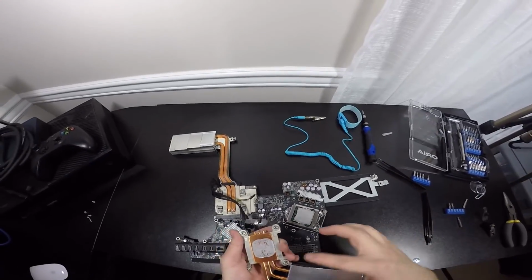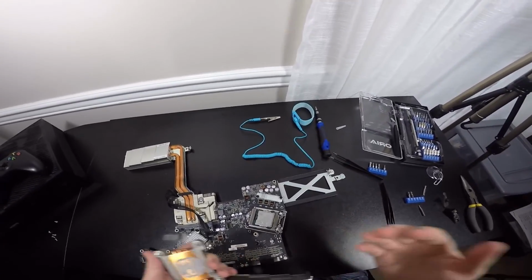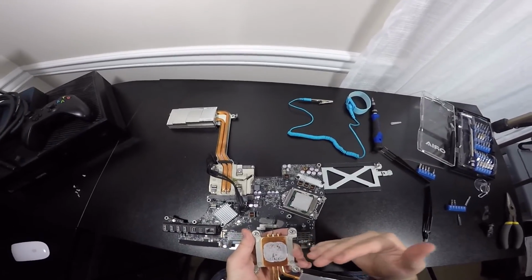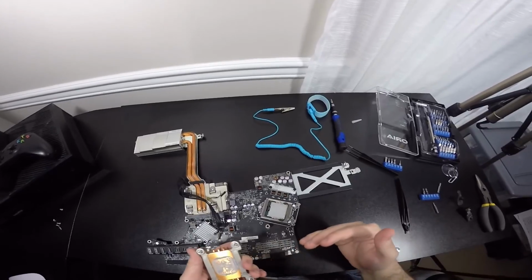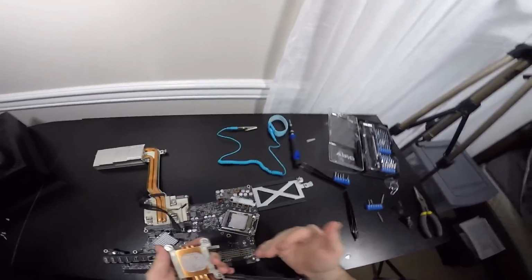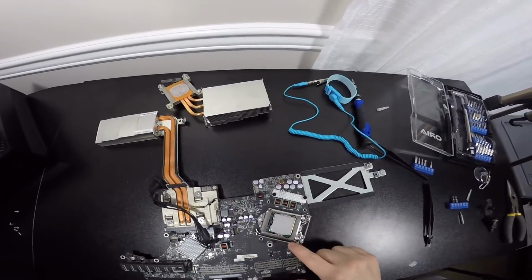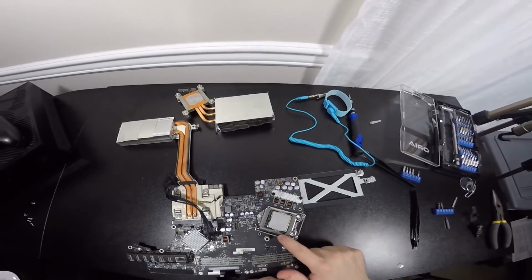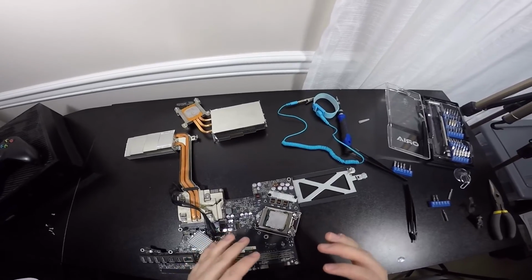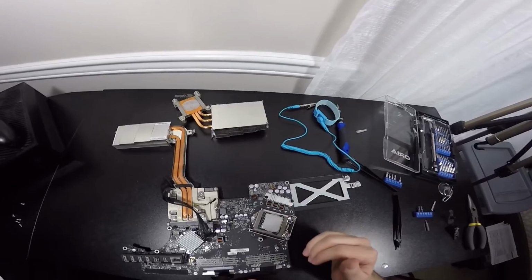We did get thermal paste. You have to clean both contacts. Don't grab anything aggressive. You don't want to ruin this heat sink here. And the best part about thermal paste is that it does not expire and it does not get old. That's the best part. So I know that CPUs, and this tab right here, is very hard. So you do have to sort of manipulate it. And don't be scared to put a little bit of force into it. It's made to go hard like that.